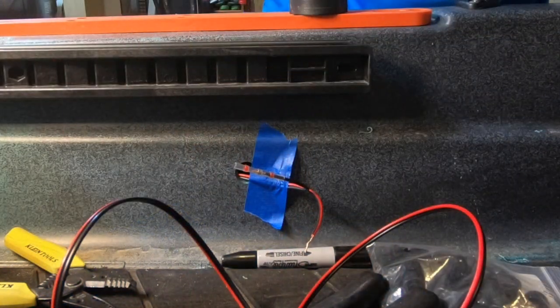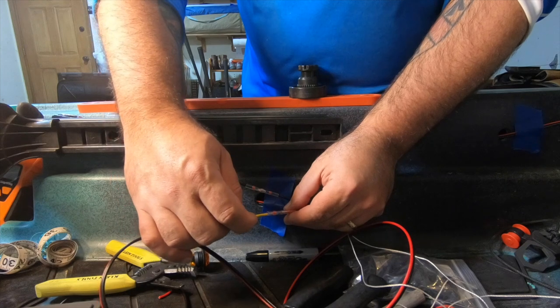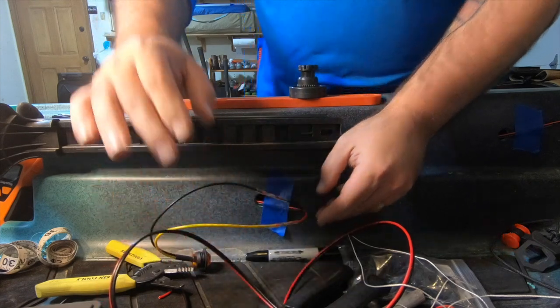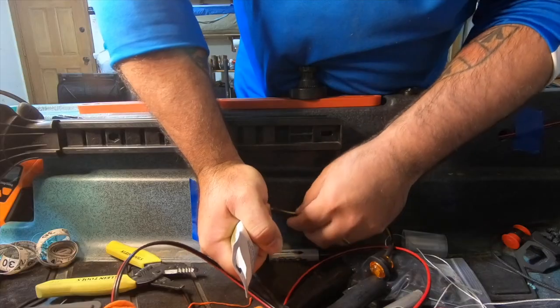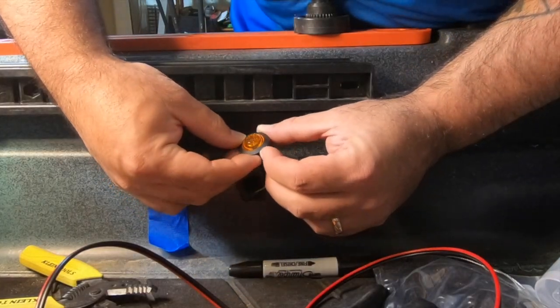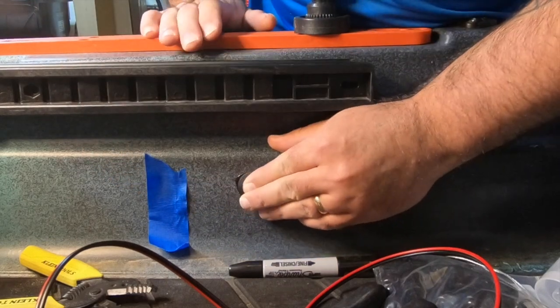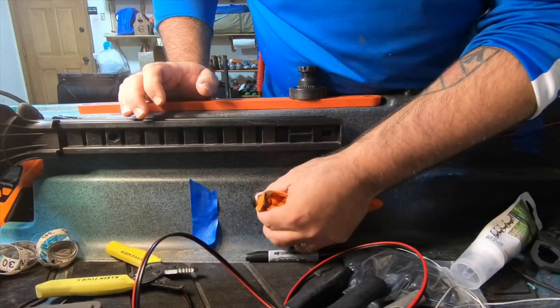All the holes are drilled, everything is fished, wires are run and taped up. The next step is connecting lights to the wires themselves. We're going to use solder seal wire connectors — it's my first time using them and they seem pretty awesome. It's a solder joint, butt connector, and heat shrink sleeve all in one. All you have to do is strip your wires, stick them in the ends, and hit the whole thing with a heat gun. The heat melts the solder and the marine-grade heat shrink seals the connection on both sides. Be careful using a heat gun around the kayak hull. Apply some silicone around the edges of the hole, then press the light in. The lights have lettering on top to help you orient them all the same way. Make sure you clean up all your excess silicone.